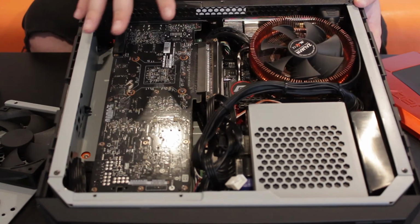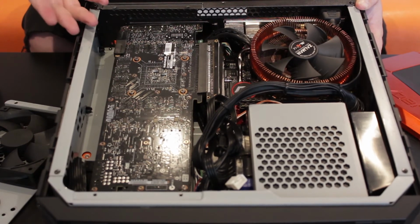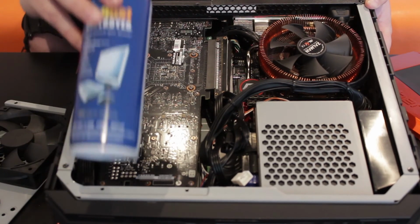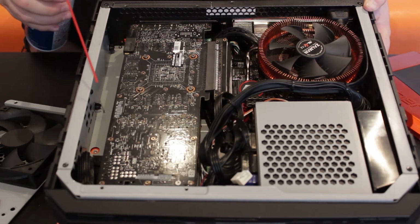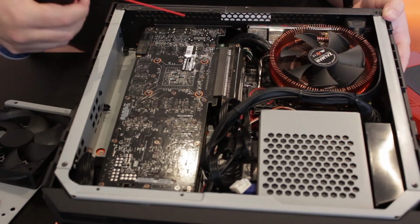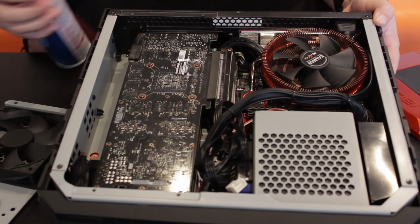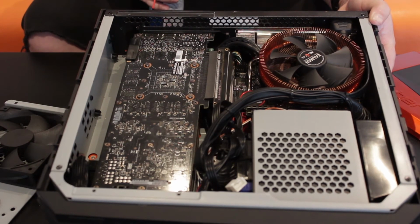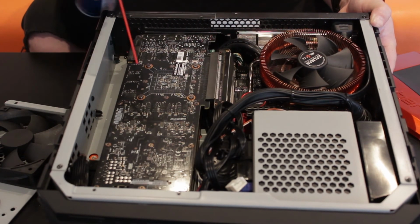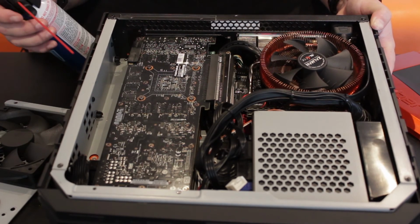Now, if you're not a person who's super finicky, you can do it other ways, by taking a brush and lightly doing it, or using an air compressor. That's all this really is, just compressed air. So you want to lightly go through the edges, and also make sure you get the back over here where the grating is. You want to blow it out, but don't blow it towards you. Blow it away from you. Don't blow inside of it, and just make sure you get all the nooks and crannies. Slowly go through it, blasting off where you see the chunks. If you keep going too long, the air will end up coming out freezing and you'll have more issues.